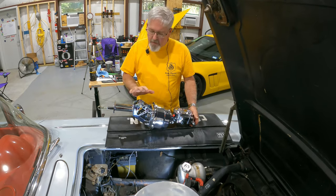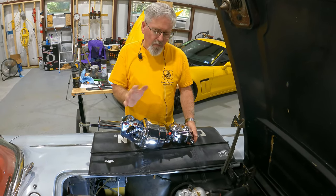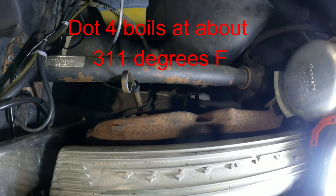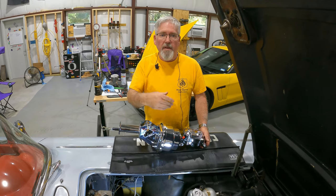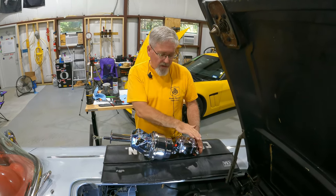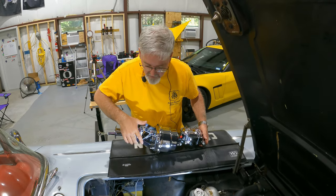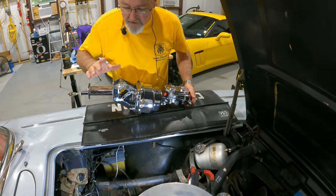We've decided that we're going to go ahead and mount it. I did not bench bleed it yet because it is going to have to come back out. Some of the tight spaces and whatnot, I've got to do some location and fitment research and figure out how I want it to go to make sure I've got the room for the brake lines to come off of it and go where they need to go, and still keep them away from any heat sources because we don't want the brake lines close to the exhaust. You don't want to boil your brake fluid because that's going to affect your durability and how well your brakes work. So I'm going to go ahead and put it back in — it's not a final install, but at least for the purposes of this video, that part's done.